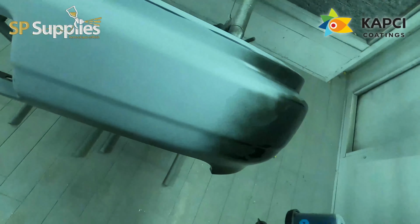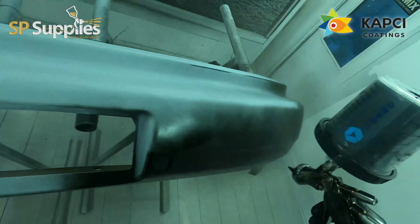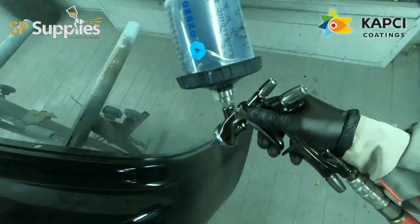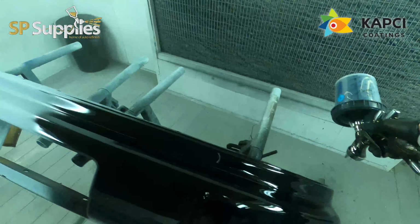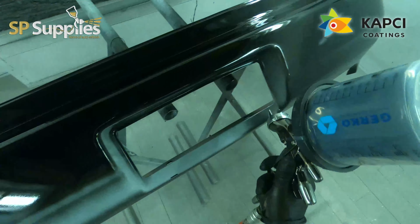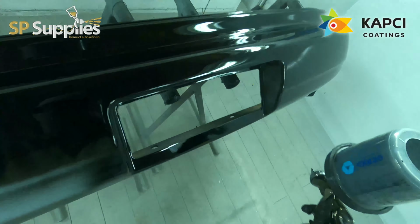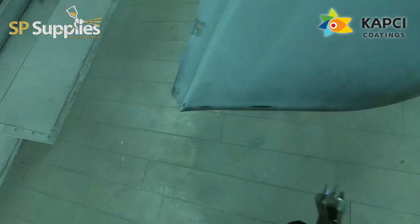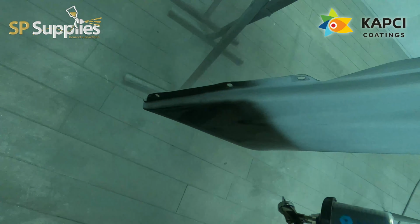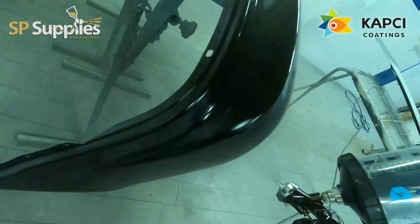And if they do get flexed coming on or off at any point, then we shouldn't have any issues as far as the paint cracking or things over flexing the tolerances that they're made to be. So I think off the top of my head, the flex additive that I had in was some of the MIPA flex additive. You just basically follow the TDS sheet for whichever flex additive that you get and add it into all your 2K products on the job. So if you know that you've got parts like this that are extremely flexible, add the flex additive into your primer before you do anything.